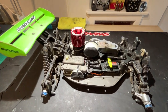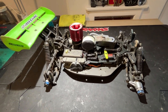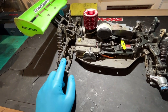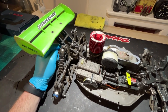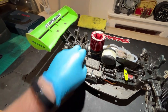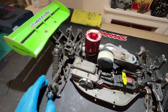Here we go, we've got the rig on the bench. On first glance it looks all right actually — we didn't really break anything major. The first thing I noticed when I came back was these nylocks were coming loose, so we'll get them replaced with some new ones. With the rear diff, it did start slipping when we were driving it, but I literally just cranked down on the diff case and it seemed to solve the problem, though it's feeling pretty rough.